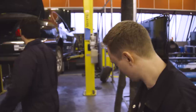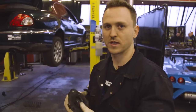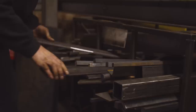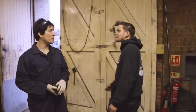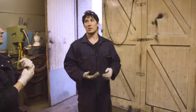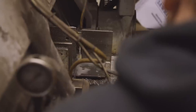Now we have the bare bones of the rear suspension sorted, we need to go back to the metal factory and get some more metal. There's plenty of space at the top — about 75mm — which is going to be even harder to put in. Materials chosen, Adam cuts two pieces of box section and two metal plates that will make up our unique spacer.